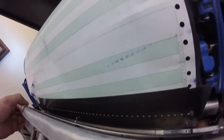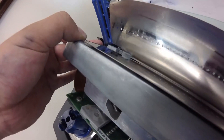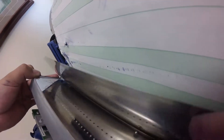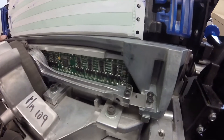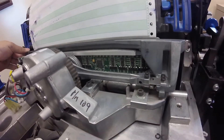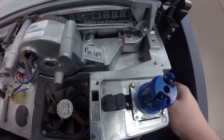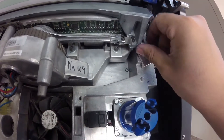You can see there's a motor that moves this plate back and forth. The hammers hit the plate through the holes. The ribbon passes between these two plates, and that's what deposits ink. So as the motor turns, the plate moves back and forth, and that's what creates drawings on the paper.